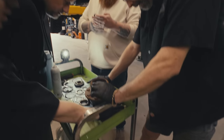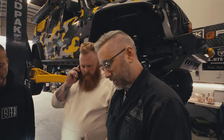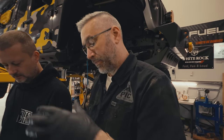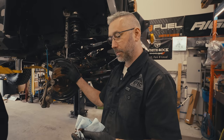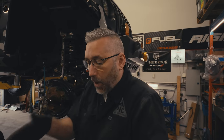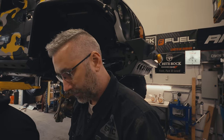And that's why it was hitting the speed sensor. Yeah, because the bearing is shot and it's vibrating and shaking. It just got filled up with dirt and mud and it grinds away on the seal. And over time, once that seal gets ground down enough, it slowly works its way inside to the bearing, between the mud and water and whatever else. And then the snowwheeling, all that front snow impacting it as well. All that water's being pushed inside, and it just eventually corroded and killed it, because the ABS sensor was unhappy.